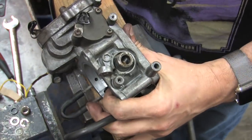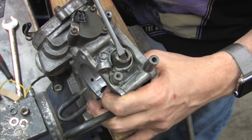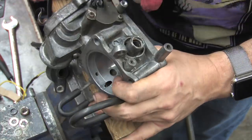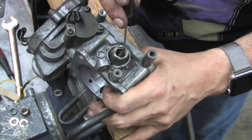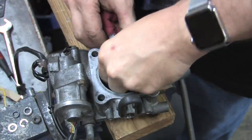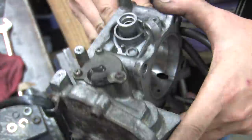You can see how the seal on the throttle linkage side is located all the way on the outer edge of the bore here. If you use a screwdriver or a seal puller, make sure to just hook the inside lip of the seal to pry it out. Don't go digging deep. It's okay to gently scrape crusty things out of the bore, but again, you just want to use the rag poke floss method with a little solvent to clean these bores up.